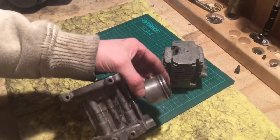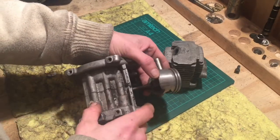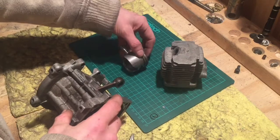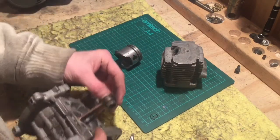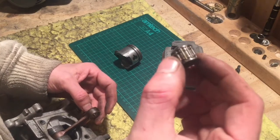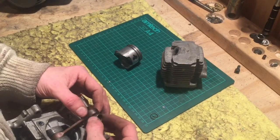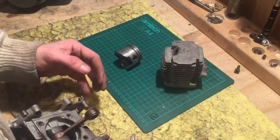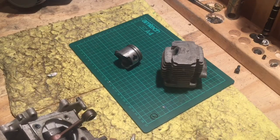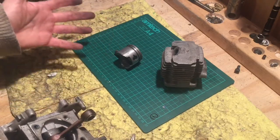As you can see it's starting to come out at this side here — you can use anything, just push on it. There we go, you don't have to push it all the way through, and there it is off. Now inside your con rod up here you have a bearing called a roller bearing — it's got loads of little pins. This one actually looks like it's in okay condition, which is surprising. If yours is okay you can keep it there, but by far you would be better off slotting in a whole new set.